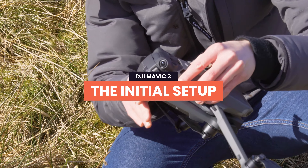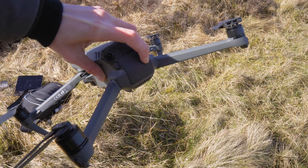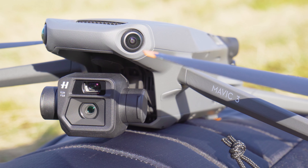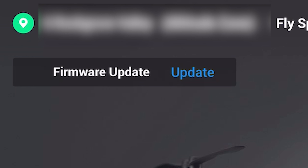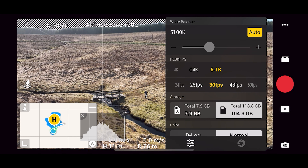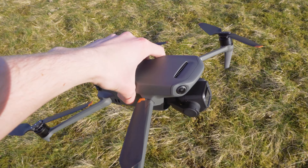The initial setup. Before you go out flying, you want to unfold the drone, put your phone in the controller, and power both on with a short then a long press of the power button on both. There are a few steps to complete for a straightforward first flight. First, download and install the DJI Fly app from the app store. Next, and most importantly, upgrade the drone's firmware to get all the latest features. If a firmware update is required, you'll get a prompt in the top left of the app. Also, put your SD card in the drone and make sure you can record video and take photos with it — you don't want to discover your SD card doesn't work when you're out in the field.